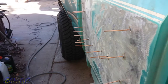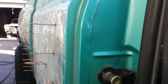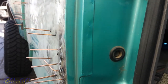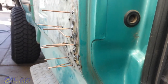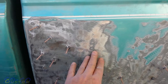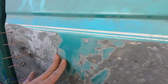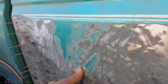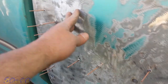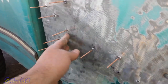Here's where we're at on this side — trying to get you a shot of it coming back and taking shape. I'm gonna get these grinded and put our first little bondo coat and get the other side pulled out. It's not so spongy anymore — I'm using the same pressure and it's moving. Before, it was bouncing in; it's not doing that anymore and I'm pushing pretty good. So I'm happy we got the sponge out.